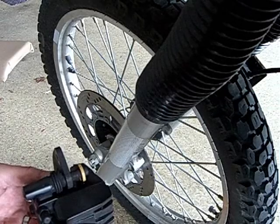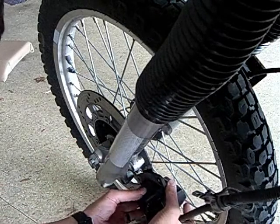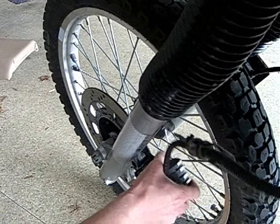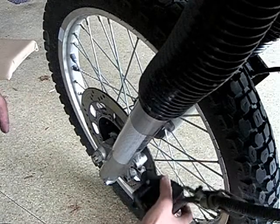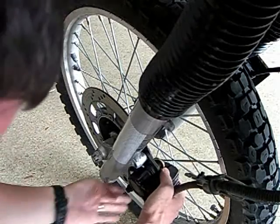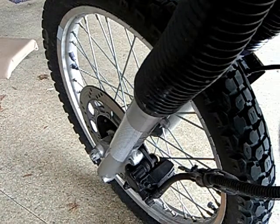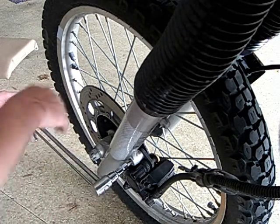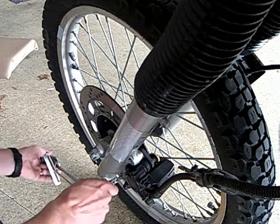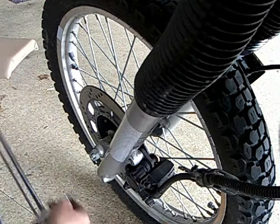Here we go. I want to demonstrate to you guys — here we've got a fail. What I'm going to try to do is open this up and put that back on there. There's no possible way that's going to go on like that. Man, it seems like it should fit — it's just right at the edge of fitting. Don't give up because that fit on there. So now I'm going to torque it up to 18 foot-pounds. There we go — and 18 foot-pounds here too. My guess is the last person who torqued these really went crazy on it.